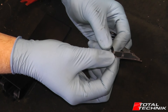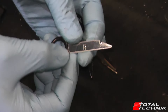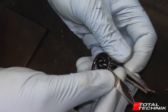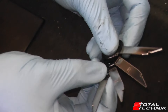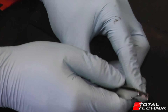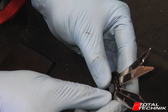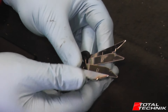These are the tools that you need to remove the Audi stereos. Most of the Audi stereos of this kind of age use this same type of tool. As you can see, you've got a straight edge on one side and a curved edge with a notch on the other. These can be bought fairly inexpensively on eBay. When you do buy your set, make sure that you buy a set that comes with four of these rather than two, because two will remove a single DIN stereo but for the double DIN you are going to need four. So if you don't have one of these kits already, do double check that it will come with four of these, and then we can get the stereo removed.